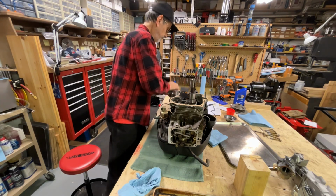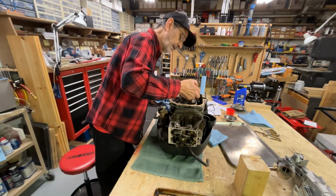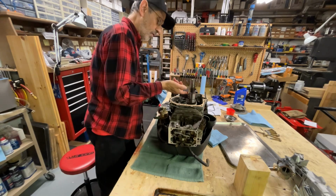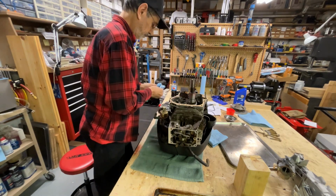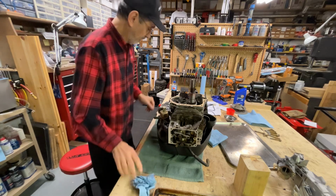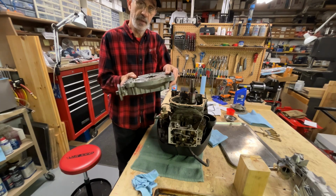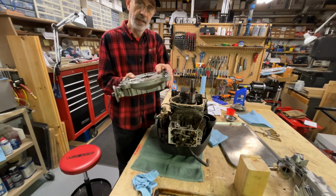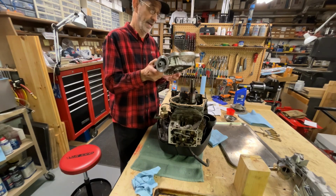First, we got to get, I want some more grease. I want to put a little grease on here to help that seal go over without hurting it. I've always found the best way to get them on is when I start to go down on it, I tip it and I get one side started first, then I push it the opposite way to help give me some clearance to get the other side down and on.